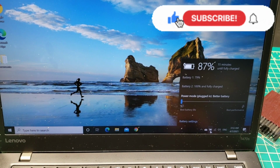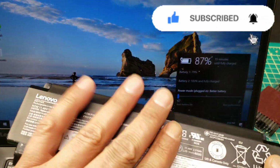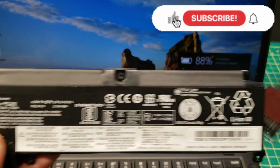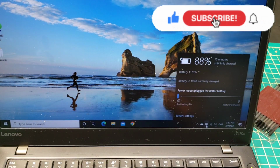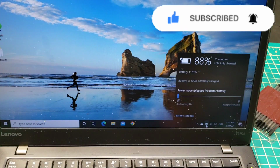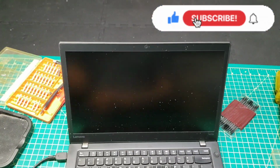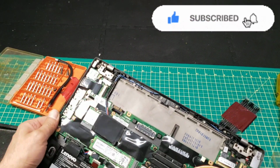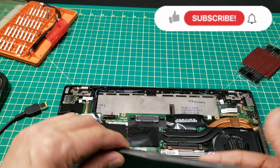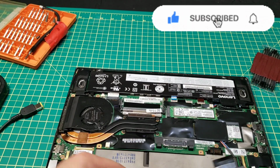And to make sure 100% that the battery is completely dying or bad, I'll take this bad battery here and install it in the other laptop, and we'll see if this is the problem. So if it's not charging, see right now it's 88%. If it's not going to be charging in the other laptop with this battery, that means this battery is completely garbage. So this is the other computer, and this is the bad battery I have from the other one. I'll install this one here, to see if something is wrong with the battery or the software.